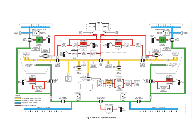Splitting the two sides—left and right—in the centre we have a 10th stage isolation valve, controlled by an isolation switch. It's normally closed, but can be opened if we only have single bleed operation, allowing the remaining bleed system to feed both air conditioning packs. The isolation valve also needs to open for a cross-engine start or if using the APU to start the right-hand engine. It opens automatically when you push the engine start button.